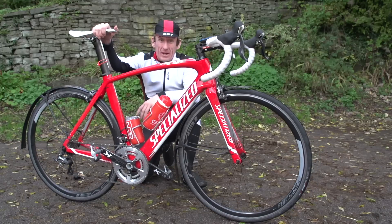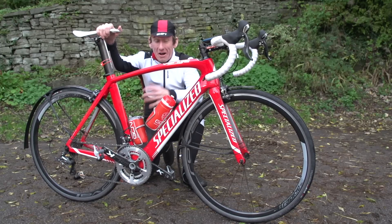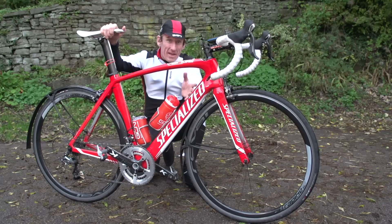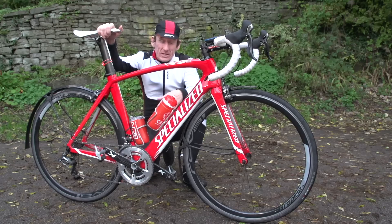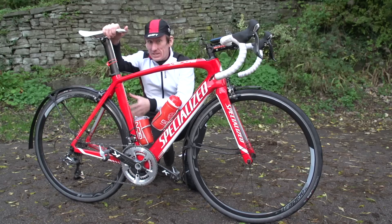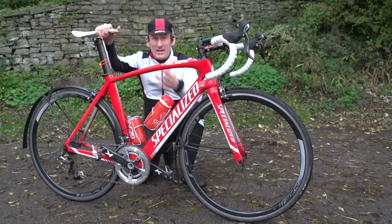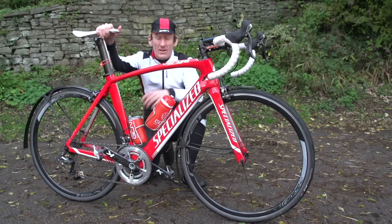Make sure you clean your winter bike. I know it's not the first thing on your mind when you get back from a very difficult, hard, arduous ride, but believe me, if you do it right then, it's going to save you a lot of time, hassle, and possibly money. Give it a good rinse off, get off all the mud and the corrosive salts on the roads at that time of year, lubricate all the parts — especially the chain, the hub area and the cassettes — and hey presto, for the next ride you're straight out onto the road, prolonging the life of those expensive components.